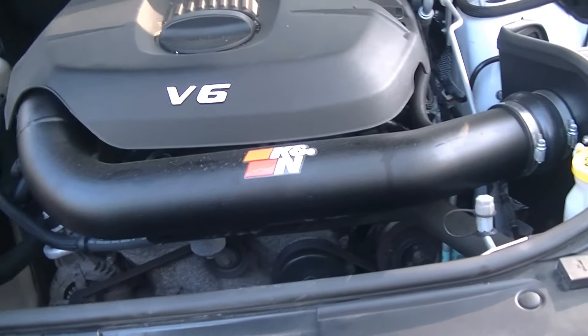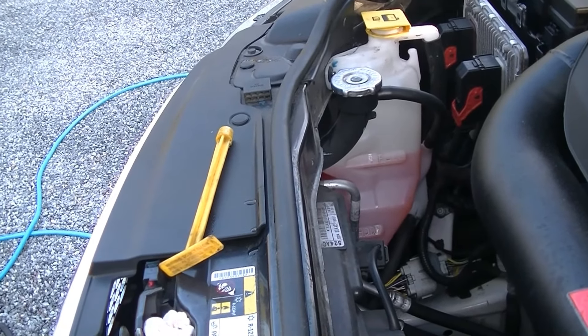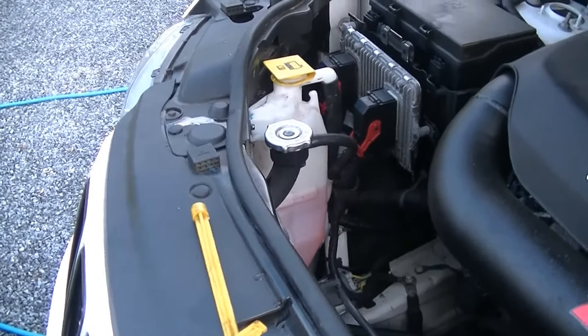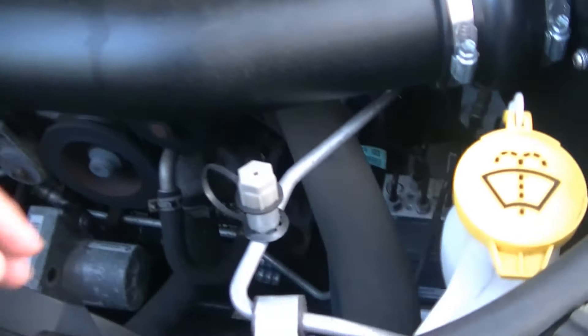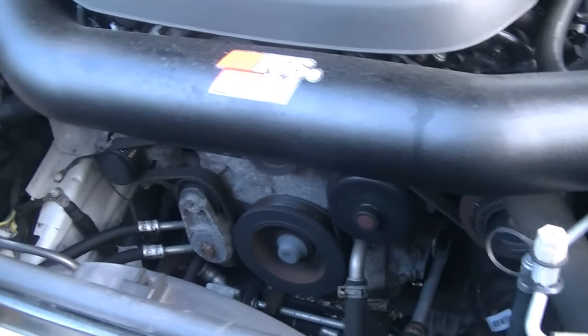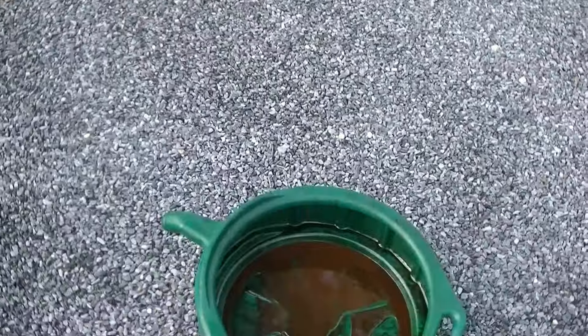You just serviced the cooling system on your Jeep Grand Cherokee. You're going to want to monitor your overflow levels for the next couple of days — make sure they stay at or around the full mark. If you did have any air pockets that self-burped, that level will drop; just top it off, that's completely normal. Check your upper and lower hoses — make sure they're both hot, and they are. That means our thermostat is open, coolant is flowing, and there should not be any more bubbles. If this video helped you, like, share, subscribe. Be sure to dispose of your coolant in an approved manner — you can take it to many auto parts stores or shops. Don't dump it down the drain; it's toxic. See you next time.